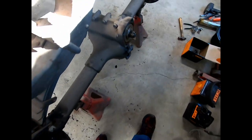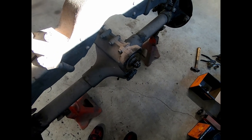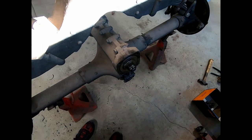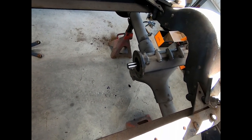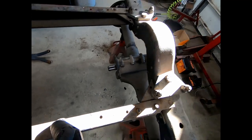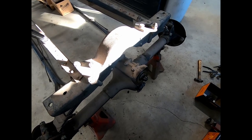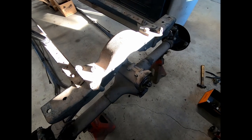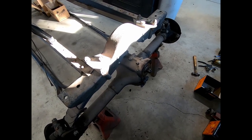We took the rear cap off the rear pinion and discovered there was no key in the nut — it seems to be tight, but it needs to be keyed. I wanted to look inside and check for an accumulation of grimy grease, but it was clean. The front pinion bearing and washer actually just slid right out on its own and it looks fine — when everything is back together, it all spins nice and smooth. We did drain the oil: it has definitely been changed in its lifetime. No water, no metal — just nice, black, stinky oil. That was a real positive note.